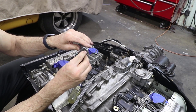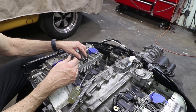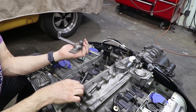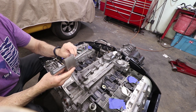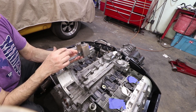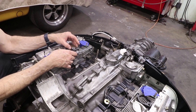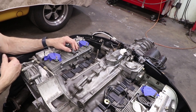This hole here is a tight clearance to M8 and doesn't have much wiggle room, and then this one here is a little bit slotted. So I can put this down and slide the bracket to get this piece right where I need it. In order for this to work, we've got to screw it together from the back side. I can put a square on here and make sure the thing is mounted perpendicular. I'm going to put some shims underneath each of the cylinders to establish the height, and then put some extra gaskets on the intake to control the position of the bridge. We'll do this the same on both sides to make sure it gets drilled right down the center.